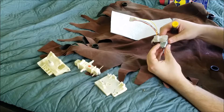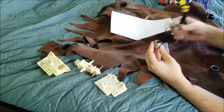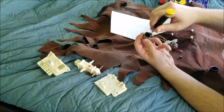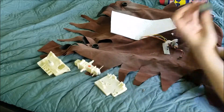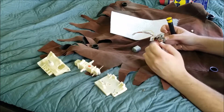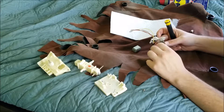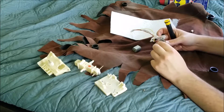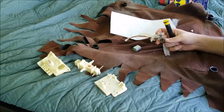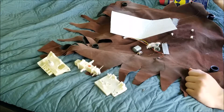So now we've got that done — we're going to slowly pull out, and the motor should very, very easily come out. As you can tell, there are two different magnets — they're completely different. Here's the core of the motor, or the rotor, which is the rotating part. Just pull this out. If the brushes won't let go, just keep pulling. So there it is. Now that we have the motor taken apart, I'm going to show you guys how to properly clean the motor.